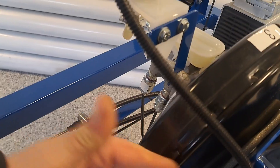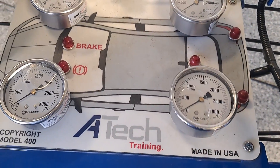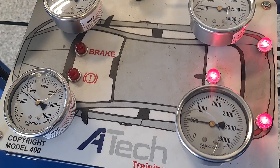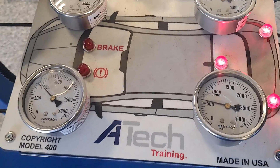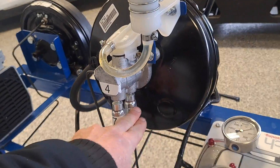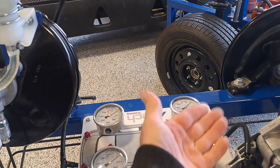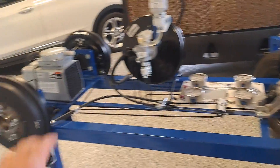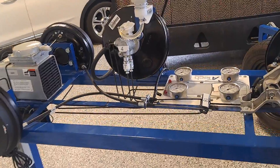The booster is using 20 inches of mercury on a large diaphragm to give hundreds of pounds of force. When I apply the brakes, front and rear both go to 400 psi initially, but as I keep applying, the rear starts to fall off while the front goes way up — the rear is around 600 and the front's over 1,000. That's because this system has proportioning valves. The proportioning valve allows pressure to keep rising at the front while limiting pressure to the rear, because under heavy braking the weight transfers forward and we don't want the rear tires to lock up and put the car into a skid.